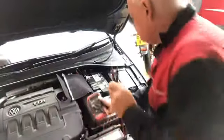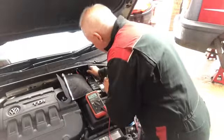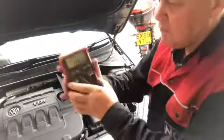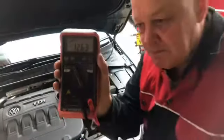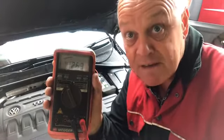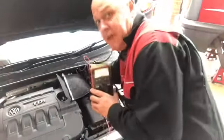This has been left overnight — this would be a scenario during the winter. We've got a voltage of 12.63 volts. Now that's fine. People might think 12 volts is good, but 12 volts is a dead flat battery. You want at least 12.50 volts to start this car. So we're happy — the battery has been left overnight and it's got a good charge. Now let's check the alternator.